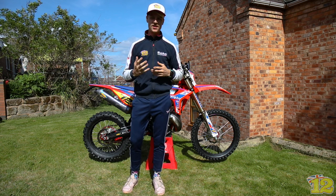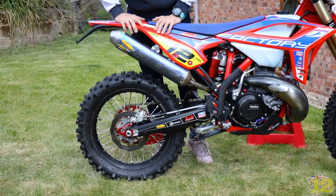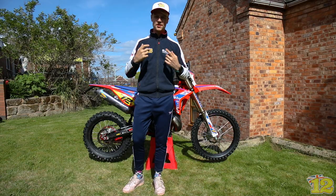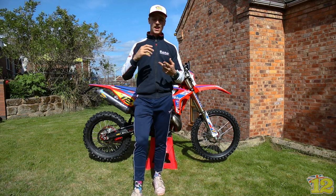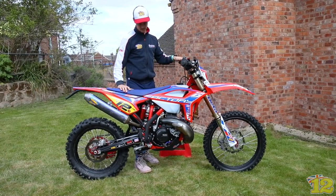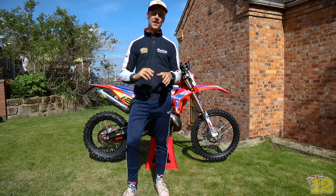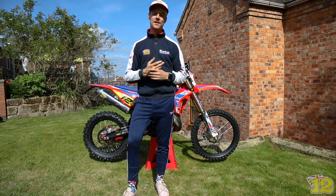Don't be afraid to try stuff. If you go to a sand track and there are big bumps and you're bottoming out, don't be afraid to close the compression or rebound a little bit — just try things. You can always go back to the base settings you wrote down. The most important thing is to experiment. I've been out testing and gone the wrong way, but that's all experience — you can always come back and try another approach. The only way you progress is by going out, making mistakes, and learning from them. With just a simple measurement or a screwdriver, you can completely change how the bike feels, and that's massively important in progressing as a rider and getting faster.